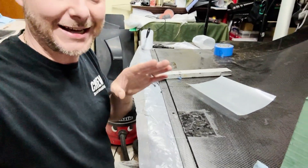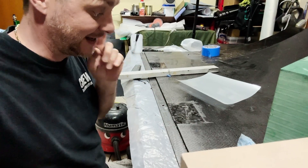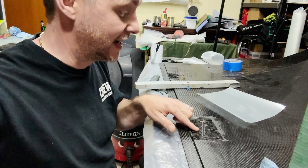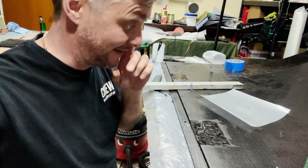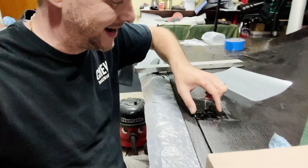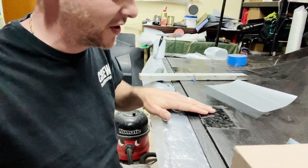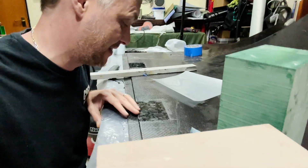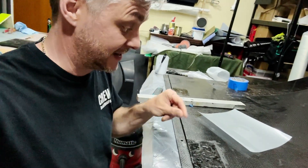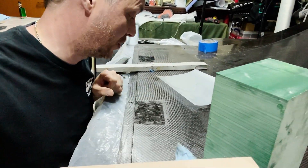Like I said, this part is not visual — it's going to be right under the car and the key is strength. This whole area is filled with forged carbon, 4mm of aluminum on the inside, a bit of Kevlar, and a bit of biaxial carbon. So this part is extremely strong — it's 10mm thick. It will literally hold anything you screw through it. You could probably even just put a normal self-tapper and it would hold.